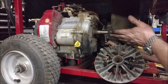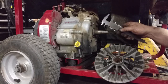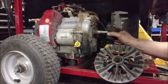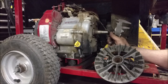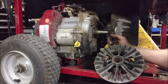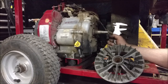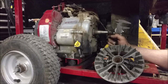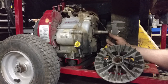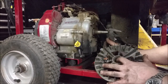If you didn't want to go to a machine shop, you could sit at your workbench with an angle grinder — since the shaft is spinning you'd get a decent edge — run the angle grinder down it and end up with a three-quarter inch shaft, then try to grind your own keyway. It would end up very rough, but it's an option. Machine shop work would probably run around 50 to 75 bucks, and a new crankshaft would be over 100.